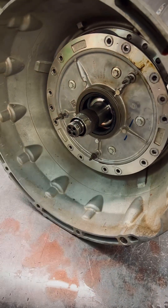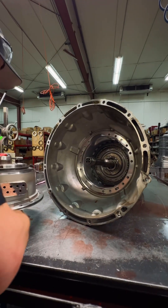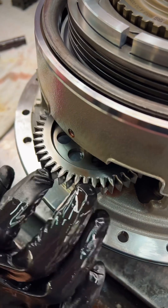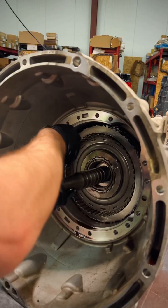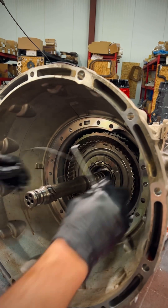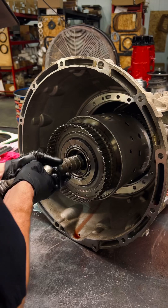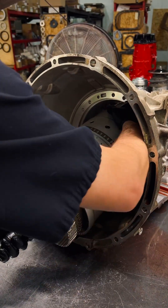The Allison likes to press out with two bolts and pulls itself right out, but I had to go grab my nifty little puller tool here to get it out. The pump gear is twice the size of the Allison's. As we start getting into this transmission, we're gonna notice the first set of clutch packs has a wavy snap ring in between each still — looks like Ford's trying to stop dragging clutches. Might be a good idea.